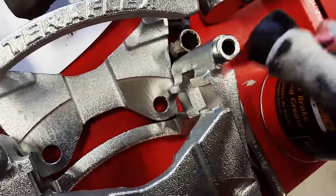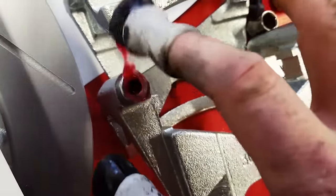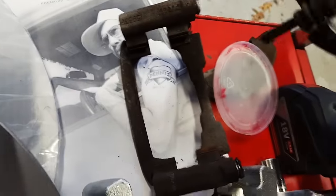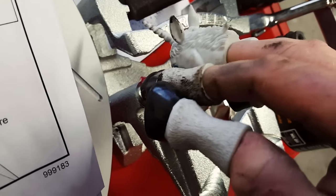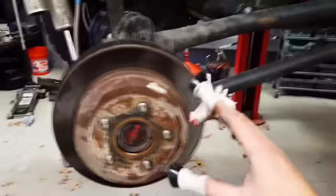Grease the slide bore, insert the caliper slides, push them down. Oh, that was easy. Let's push that one down there like that one. Awesome, man — this is real easy. I'm going to clean this grease off my hoof. Next, we've got to get this worthless factory rotor off here. Just kind of wiggle it back and forth a little bit until it finally comes off. Bye.